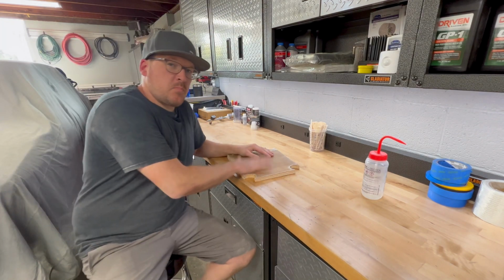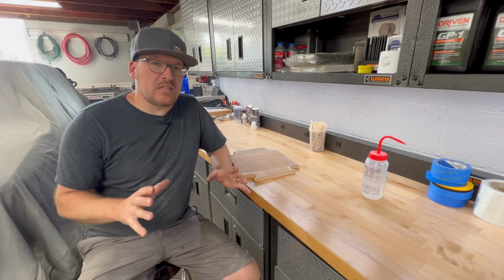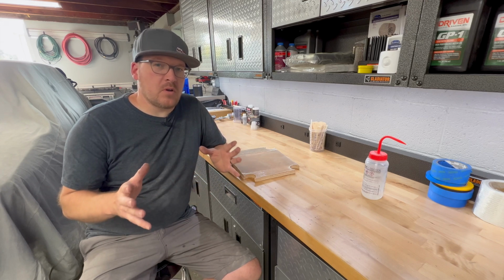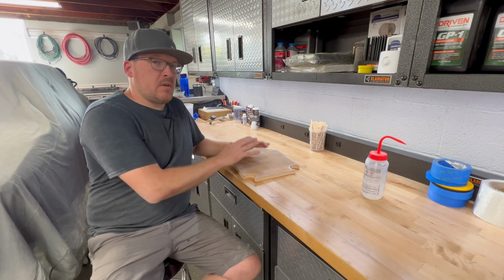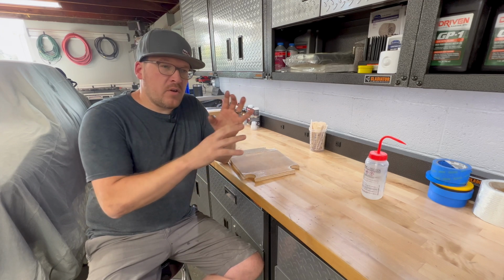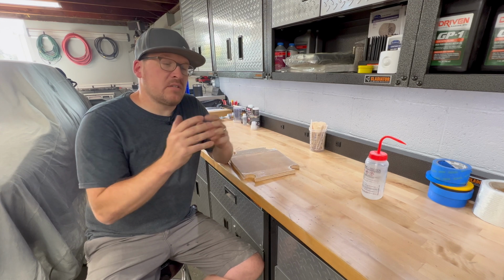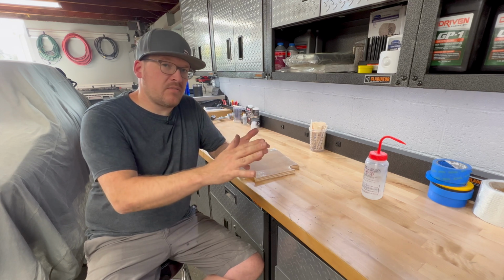Now before I get into this test panel and what I have planned on doing, I kind of wanted to mention some things that why I think this is a little bit different and gets a little bit more complicated. Now most times, or any time that I've talked to people that have done gel coat, specifically multiple color layups and gel coat, not a lot of them have done them outside of a mold. They've done them inside a mold. So that process is pretty straightforward, where you have to go ahead and be very methodical on your layout of your masking, and then you don't have to worry about the wax additive and the gel coat because it doesn't need anything to surface cure, because it's going to be sealed on the inside of the mold, and eventually the fiberglass over the back of it's going to seal it.